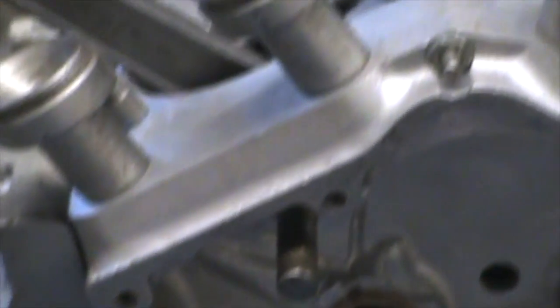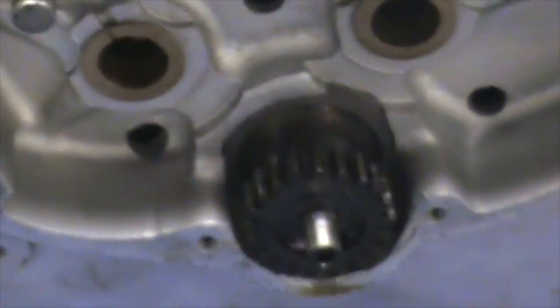When I first inspected this engine, I couldn't get that to move at all, so I put a dial indicator on that little spigot sticking out that goes toward the oil pump. That dial indicator moved ten thousandths of an inch. The bearings were also all too tight, so I don't know how far out of bounds it was.